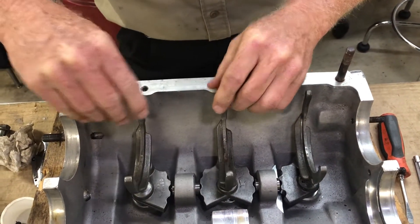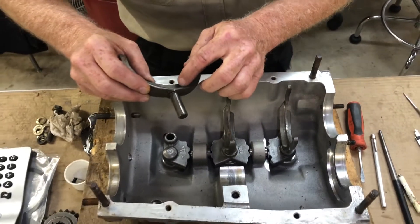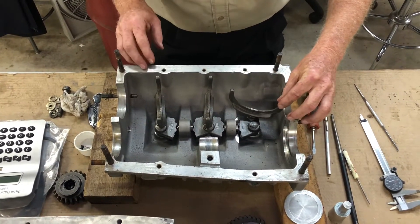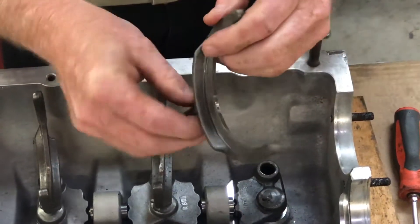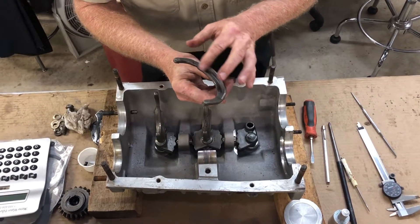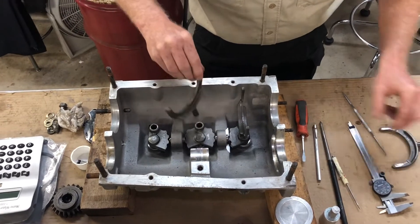Before you take the forks out, I like to mark them with your electric pencil, writing on areas that aren't contacting or sliding into something else. You could mark one and two on the front side of the fork so you know the direction it goes in. You could mark one through six — and the five-six fork is different. Make sure that you get that fork back in its proper location because it's machined thinner, because the sleeve is thinner. The little pads on all of these are facing the rear, and the part that's not machined has been facing the front. So make sure you get all these pieces back as they are — mark them so you know what location they go back in.